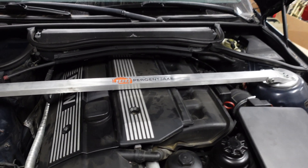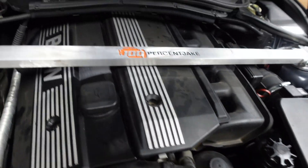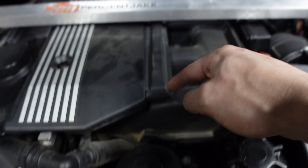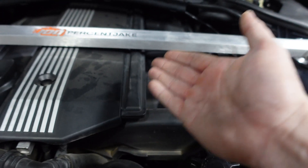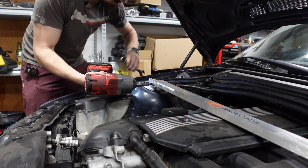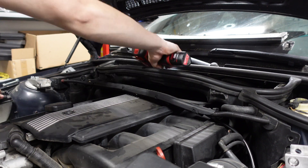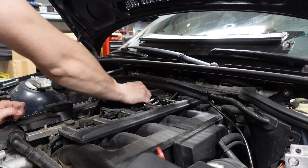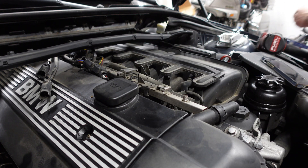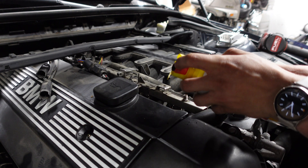There's not an excessive amount of stuff that needs to come out of the way here. We're going to take off the strut tower brace — which isn't actually screwed down on my car, I never did find hardware for that — and then take out the air filter tray to get access to the hoses under there. One of the hoses we'll be dealing with is here, as well as what I'm calling the vacuum distribution manifold. We're going to remove it using a few Torx screws, and I'm putting some penetrating oil where they go into the intake manifold to avoid tearing the rubber rings in there.